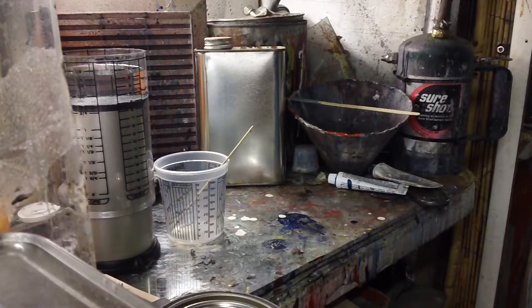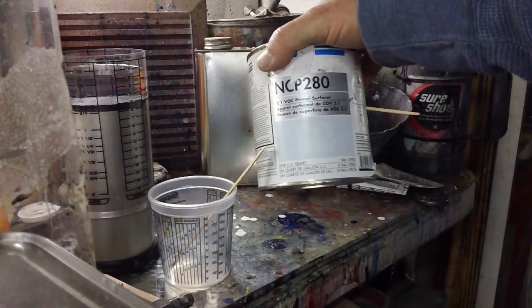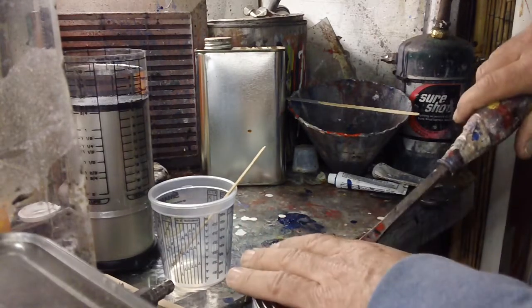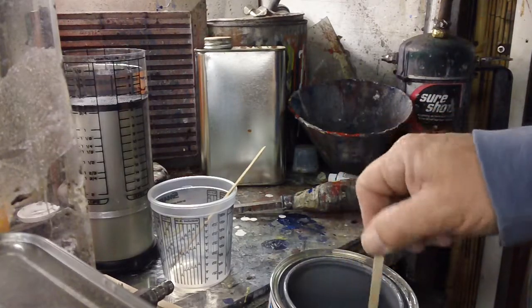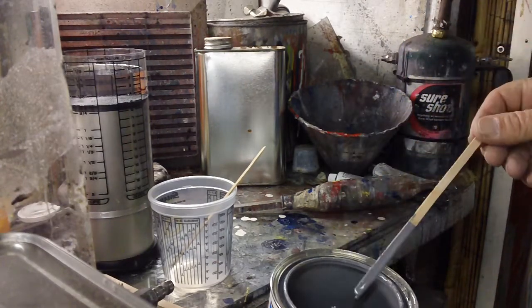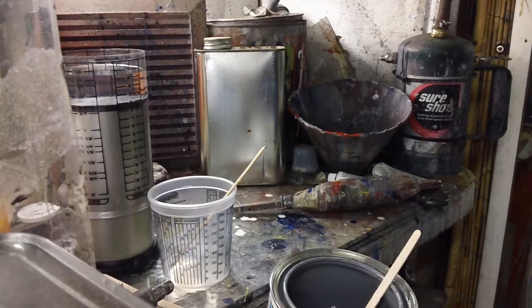Now, the purpose of today's viscosity test is, remember, I said I could paint this, and this is some thick primer. Even with its hardener, it even gets thicker, I think. I can paint this or the thinnest clear I would want through that one gun with that one fluid adjustment. This is a stir stick from Starbucks. They're free. I'm going to put a drop of primer on that can, and we're watching it run down the can while I'm putting the lid back on.